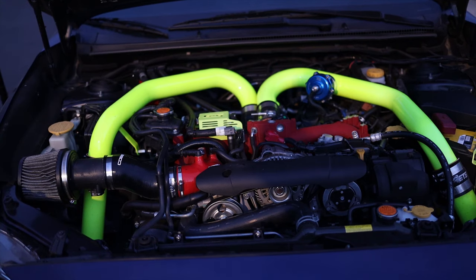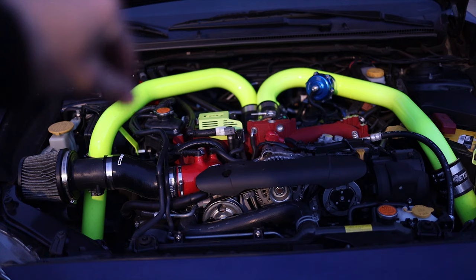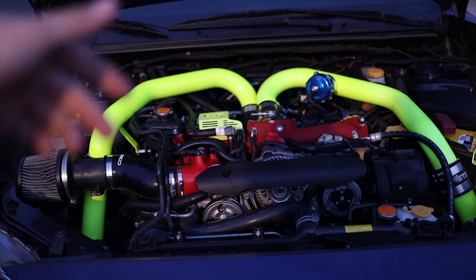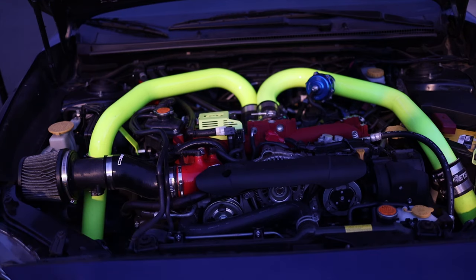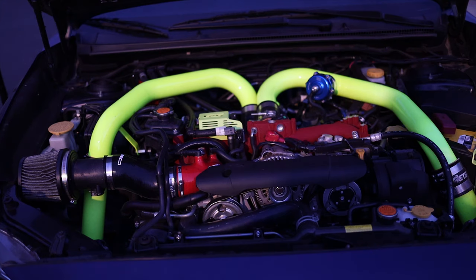I took the no-spill kit off, put the plug in, soaked up any coolant inside the reservoir cap, and put the OEM cap back on — that's the complete install for the cylinder 4 cooling mod. I checked for leaks with the car off and lifted it to inspect all the hoses; everything was super dry and looked perfect. I'm still going to take the car on a drive and then burp it one more time tomorrow just to make sure there are no trapped air bubbles.